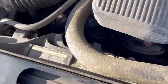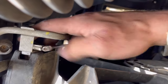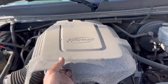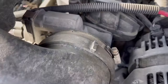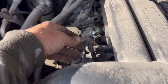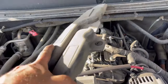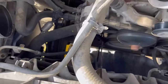Then we have a 10mm over here on this transmission cooler line. I'm going to pull it all the way out just to give me a little more room. I popped this engine cover off and then I took these two 8mm worm clamps off. You've got this little fitting right here, and then this just pops off some dowels — easy enough to give you more access and more room to work on stuff.